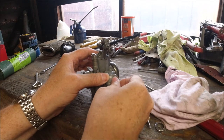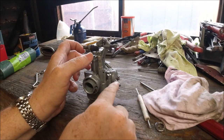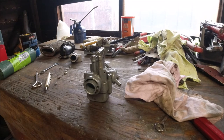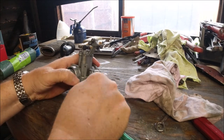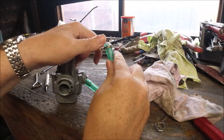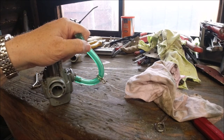You're better to have it in the position they put it in, because where your petrol tap is and you've got your fuel pipe coming down, you need to leave a little bit of a U-bend on there. Most of the sediment from a rusty petrol tank will sit in the bottom of the pipe. So your pipe would go on there, and you'd have a bend — because this is a low point, you should always get your sediment there.